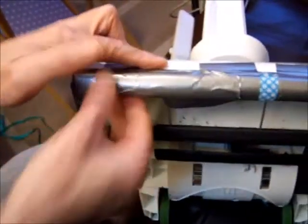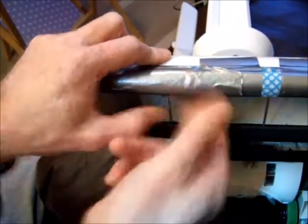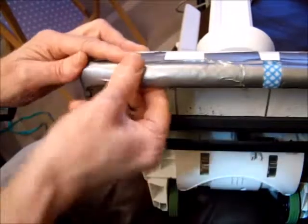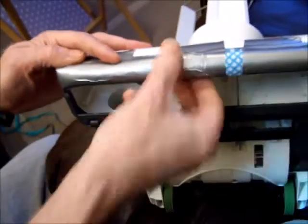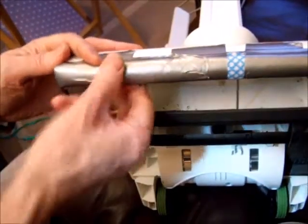Okay, the job that this is doing is raising the vacuum up, and it's taking away some of the excess suction, allowing it to operate properly without the rotor. You can see here, if I point, this is where your dust and dirt goes in to the vacuum. Okay, so it's unobstructed now. This will be much more efficient than it would be with the rotor arm, and it's not going to burn the motor, because that was the problem with the rotor on these.